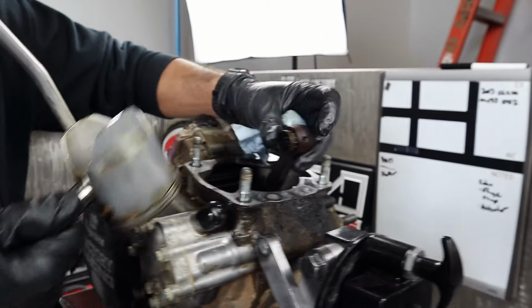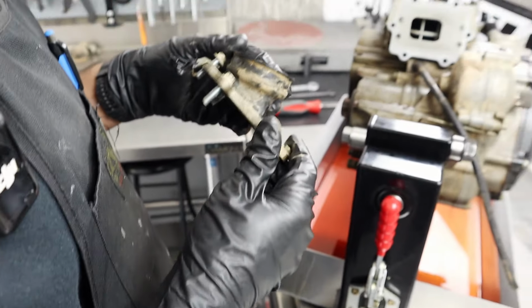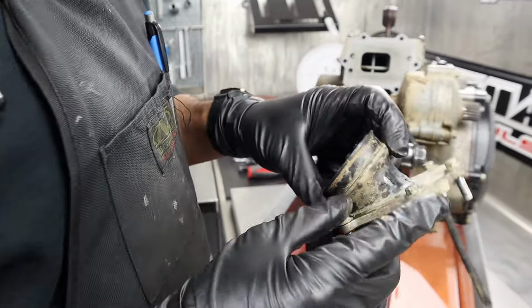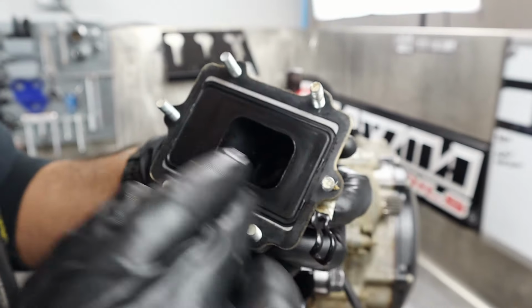What do you see on the inside? There's a lot of crud. So you got that intake boot off. Anything suspect going on there? I'm just looking for dry rot. A lot of times these things will dry rot out, sort of sucking air. On the clean side, it looks good. Any kind of breach or failure? Nope. That looks good.